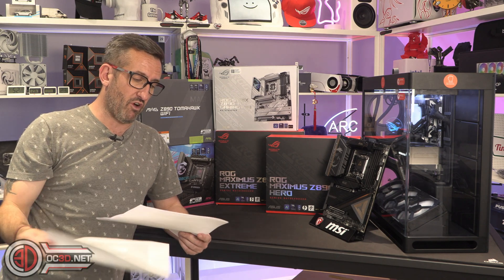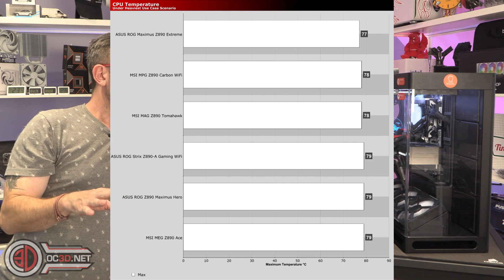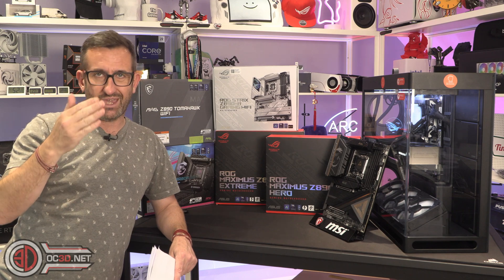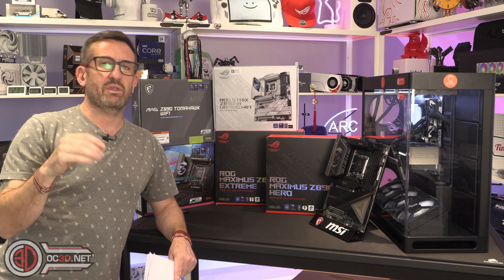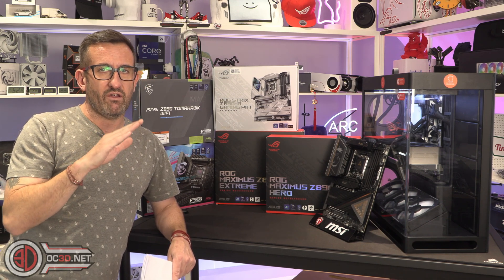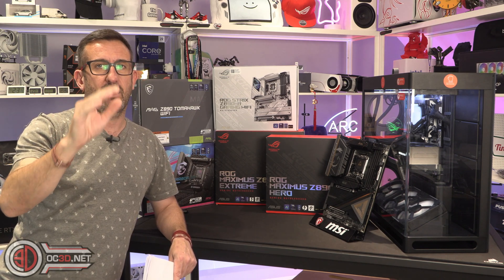VRMs were great. CPU temperatures are all very, very close, and it didn't seem to matter what I did with the fan profile. I could bring them down a little bit with a crazy fan speed, but I never really saw anything over 80°C. That's something I'm going to dig into because I'm wondering whether this might be a very purposeful limit that Intel have set.